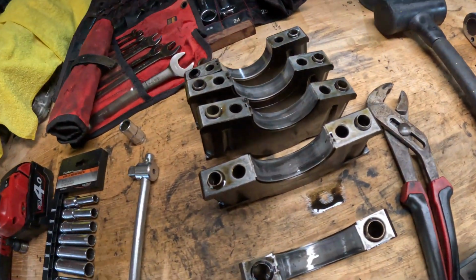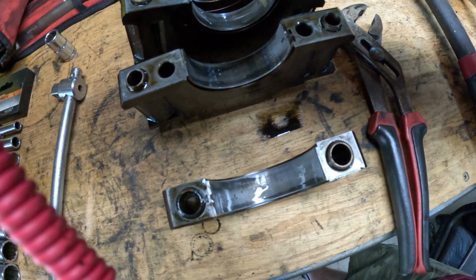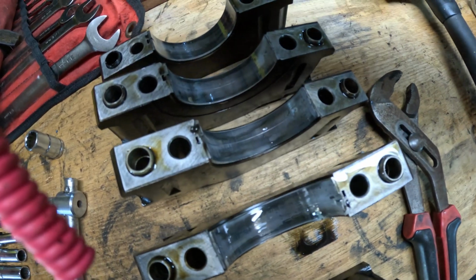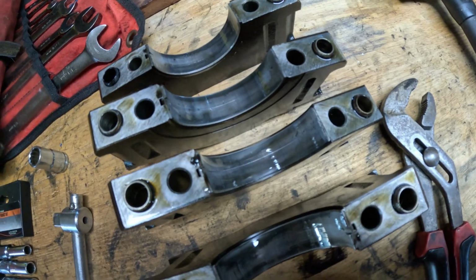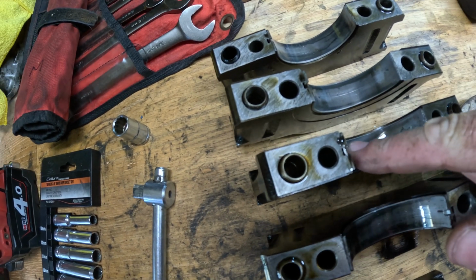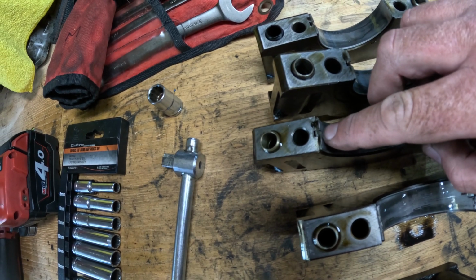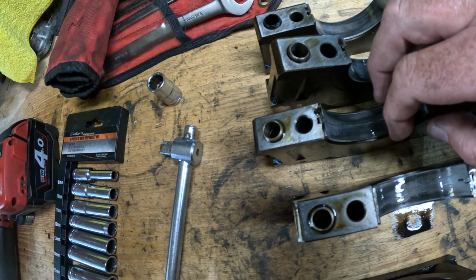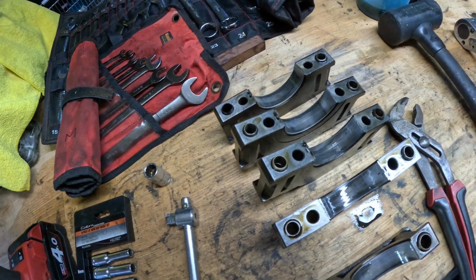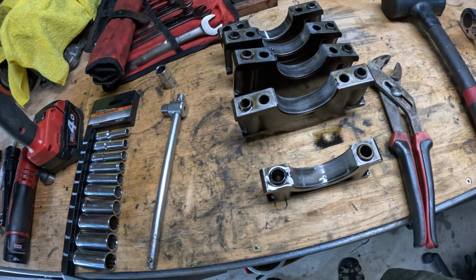And if you look at the bearings, well, the bearings are worn, but nothing crazy. This one here, you can see there's a couple of these have got sort of lines where obviously a nugget or something's got stuck. It looks like it's almost got stuck in just at the tang there and been dragged around before getting spat out. But no, she's pretty good.